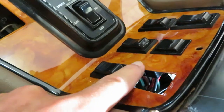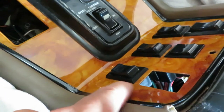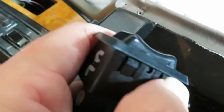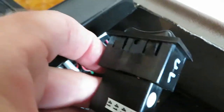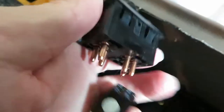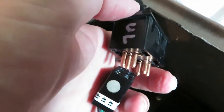Be sure and label them — you can use tape or a Sharpie. The switches are easy to get out when you have everything apart. You push them on the back side with one hand and wiggle them and pull them. There are some little snaps right here, but they pretty much pull out. Push from the back, pull from the front, and the switch will come out. These connectors come off the switch — there's a six-pin connector. That's how the window switches come out.